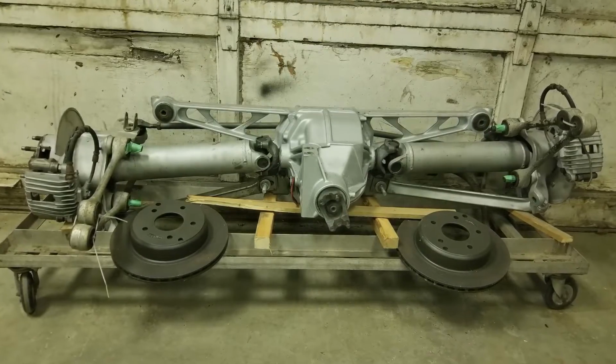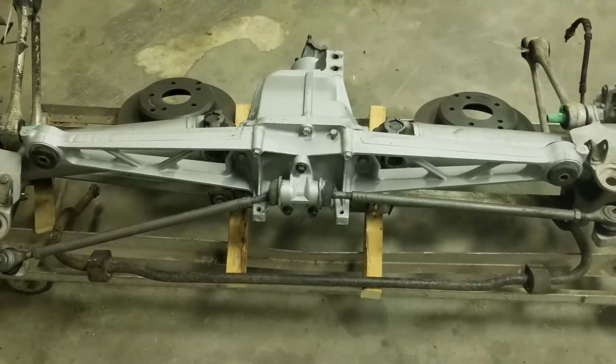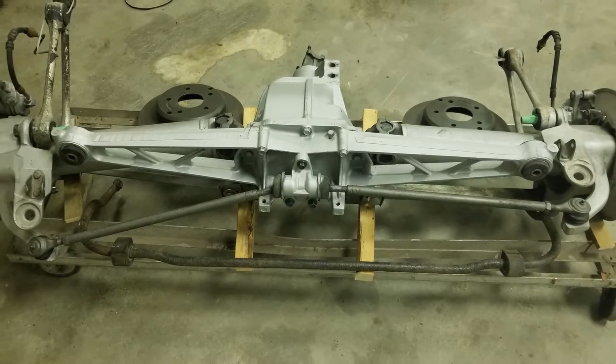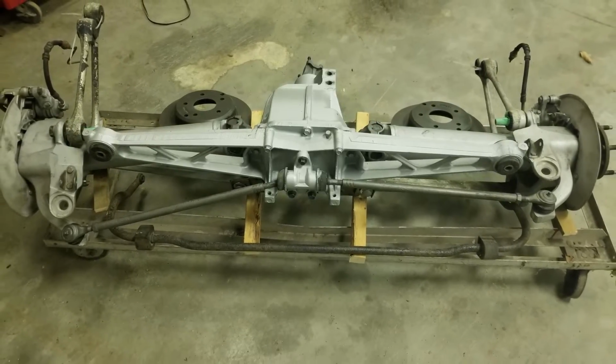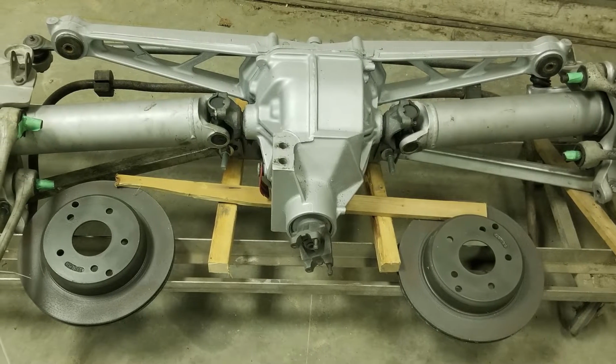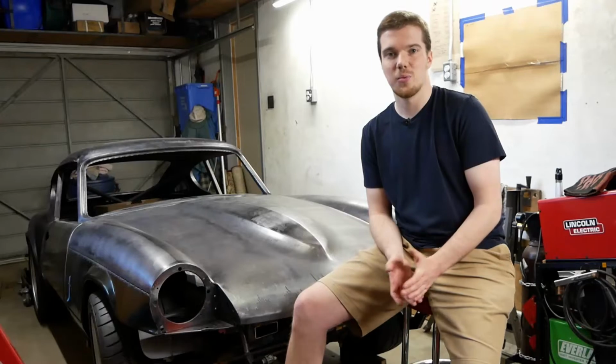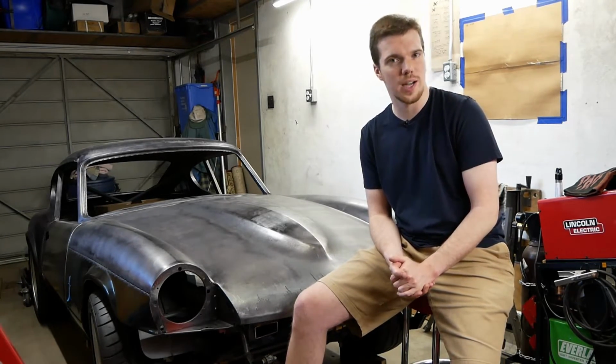Turns out there is. This is a complete Dana 36 rear end from an '84 Corvette. Keeping with our oddball parts hunting style, the Dana 36 is the rear end you don't want. Typically found in the automatic Vettes, it can't handle as much power as the Dana 44s from the manual Vettes and early Vipers. It will, however, handle the power we're going to make, and doubly so as we're not running wide drag radials on a heavy car on a racetrack.